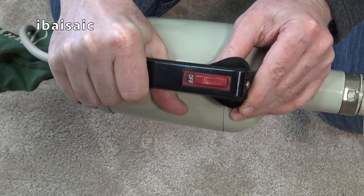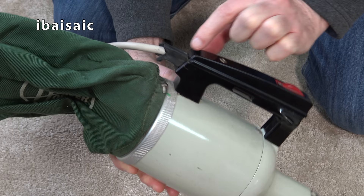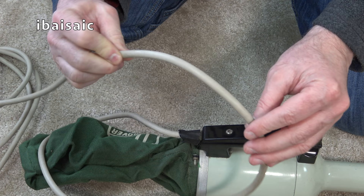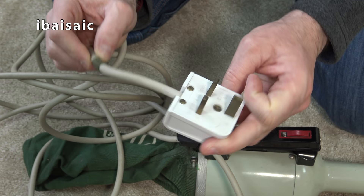We've got a slide on-off switch, clearly marked off - slide it back to switch the cleaner on. The cord protector grommet has perished as you can see. The cord does seem to be original - it's a sort of off-white or taupey colour, but it's a ribbed cord. And if you want to see the plug - let's have a look at the plug. Which is an EverReady. Whether it's age-appropriate I don't know, but it is an older plug because there's no insulated live and neutral pin. And it says Made in England on it.